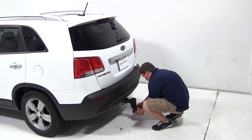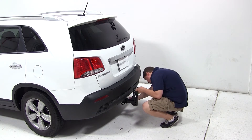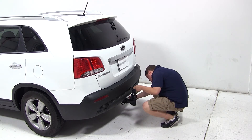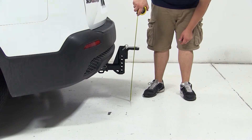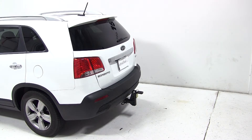We'll go ahead and flip it over and install the convertible ball mount, part number BA1. With it in the rise position, with our ball mount extended to the top, we have a platform measurement of 18.25 inches. This is measuring from the ground to the top of our ball platform. If this measurement matches yours, then this would be a good choice for you.